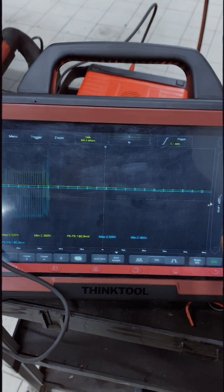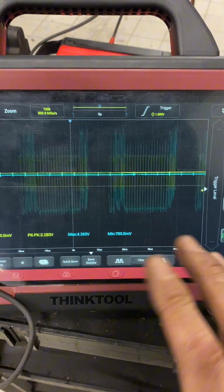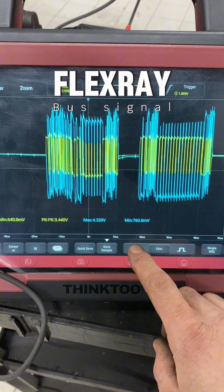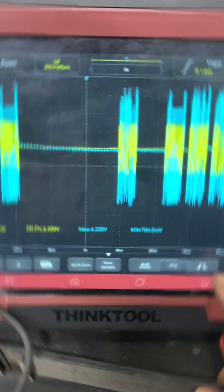This is a FlexRay signal and it's so fast I've had to use a probe with 10x resolution because the normal probe simply won't cut it. I've got an F11 here — I wasn't going to make a video about it because I assumed it was going to be an issue with the air suspension. They were saying the car goes up, stays up, and sometimes it's too low. But I've just been to the car and we've got a fault with the FlexRay bus.